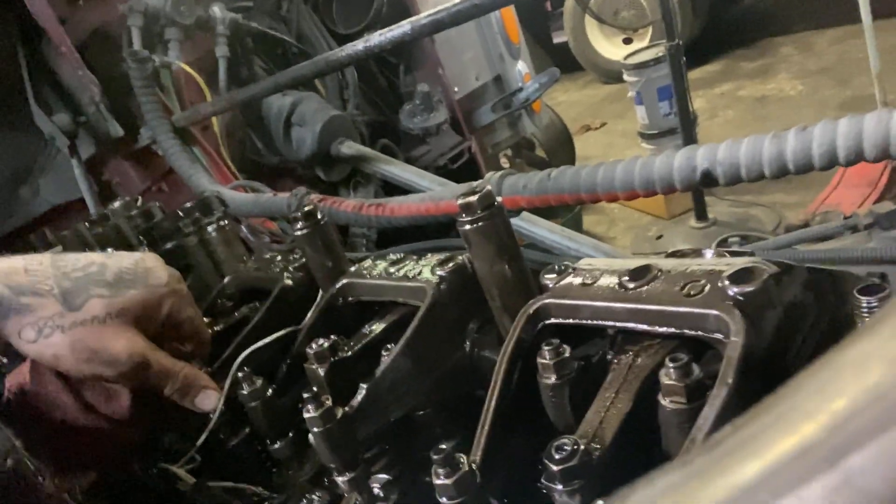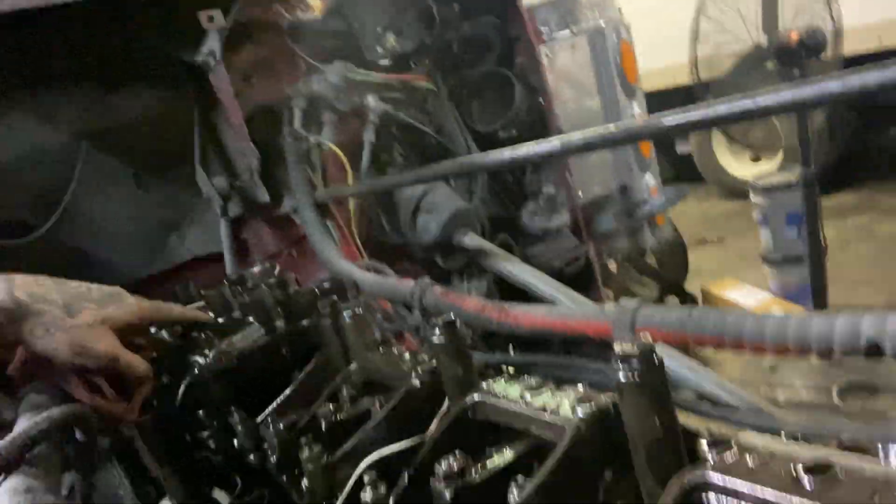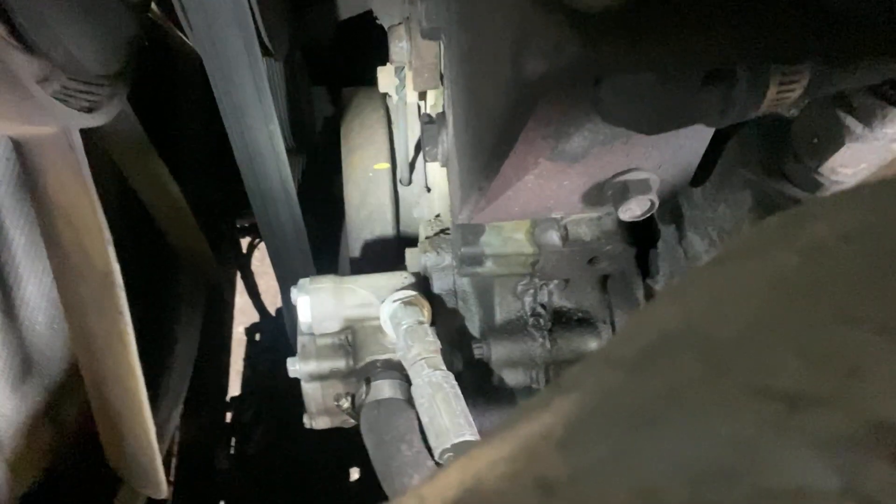Once you get it all disassembled and get these back in here, torque those to 90 foot pounds and get it ready to go. Now, other than putting it at top dead center, which I'll show you here in a minute, we're ready to go ahead and adjust this side. There's a little hole right down here — I got a drill bit in it. If you look straight down through it as you rotate the crank over, inside the crank journal itself it has a little hole in it. That's gonna set it top dead center 180 out.